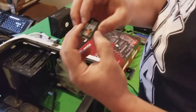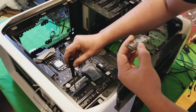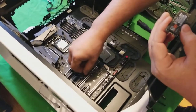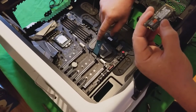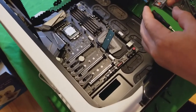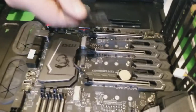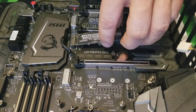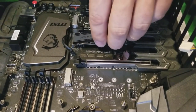This is the 500GB NVMe SSD by Samsung. What you want to do is pop this little screw off. One weird thing about MSI is they have a heat shield on their M.2 slot here. A lot of people don't like it because they say it actually acts as a blanket — it's supposed to be a heat dissipator, but some people say it actually warms up the drive instead of cooling it down. What you want to do is get your little drive, get your set screw, back it off, and put it in the very back. Pop your drive right in there.